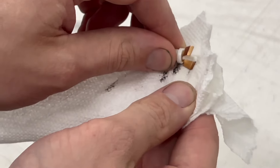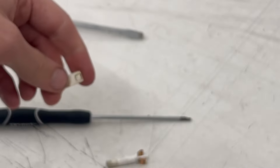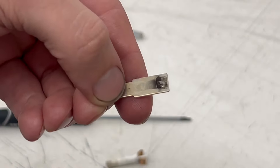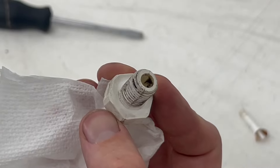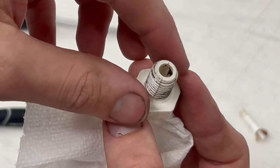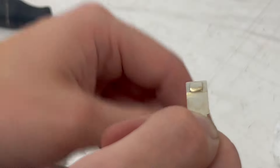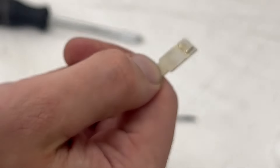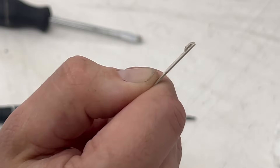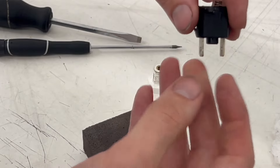Just a little twist and it popped off. Here's how it makes contact — you can see on the spring in the plunger, it slides up and down like that. And look at that — that is pretty gunked up. That side's not too bad, but this side is especially dirty. So I'm just going to start by cleaning this off. There doesn't really seem to be a ton of wear on here; it's more so almost like grease that has gotten in here — dirty grease. Popping out both these pins. This one is especially nasty as well. It looks like this grease inside the switch is probably getting pushed down over time onto the contacts.